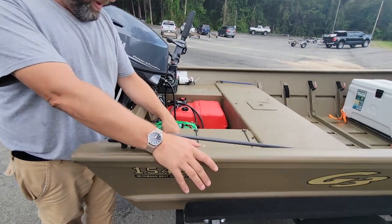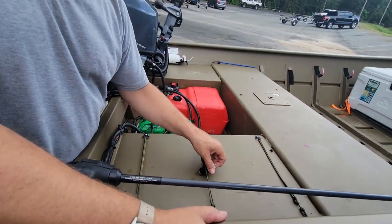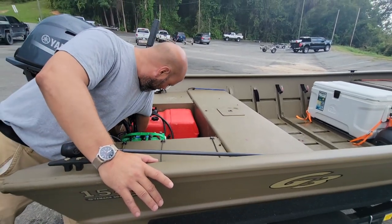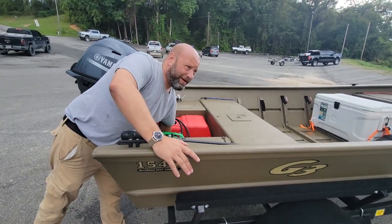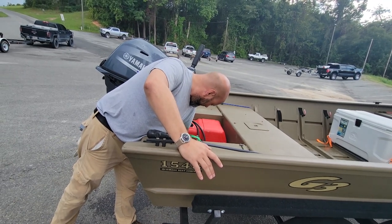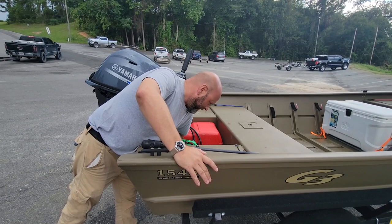Notice this — that's where I keep my boat plug. It is not in here. This is to remind me that I have to put it in. If I do not put this plug in, we sink. So the plug has to go in. Set the plug in, make sure it's in good, twist it in. I like these twist ones way better than the cam-over ones. Lock this in and get it good and tight.